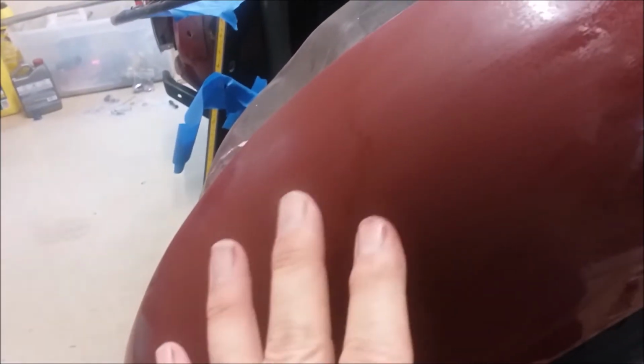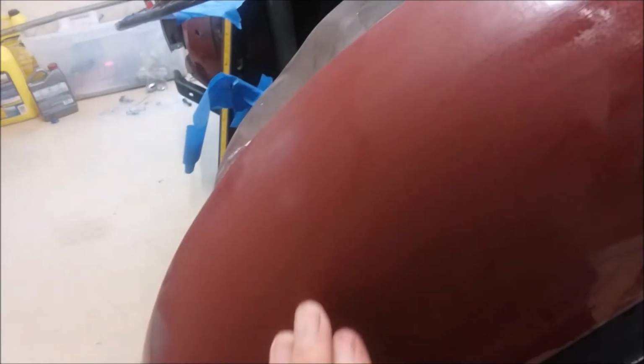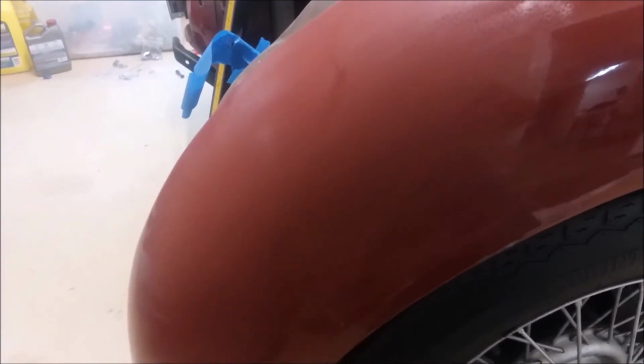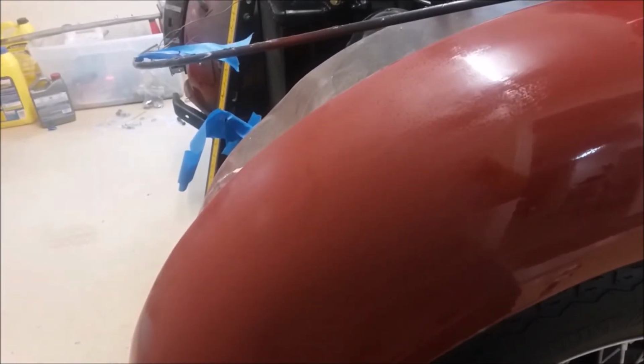We'll see what happened. I brought it all the way back to here with the 2500. I didn't do this with the 1000 grit. I did the 1000 grit on up right on the area where there's the fog. And then when I hit the 2500 grit, I brought it all the way over to the new paint. And now I'm gonna try the compound and see what that does. It's almost done. I can't wait to see if that made a decent repair.